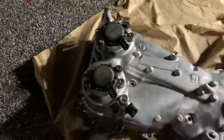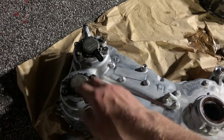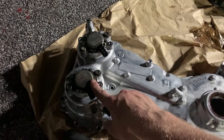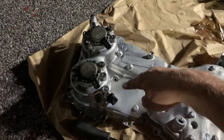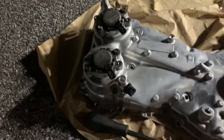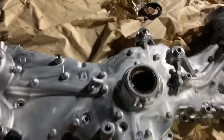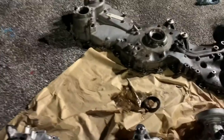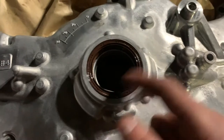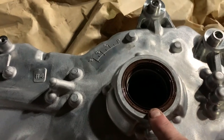You have two seals on each camshaft — sorry, not camshaft, but the sprocket reader thing. You have a yellow ring and you have a black o-ring. I believe it is the black o-ring farthest down, and then the yellow ring is all the way up — you'll understand once you pull one off. You also have this main seal here. It goes this way; if you see that spring around, that's the opposite way — flip it around.